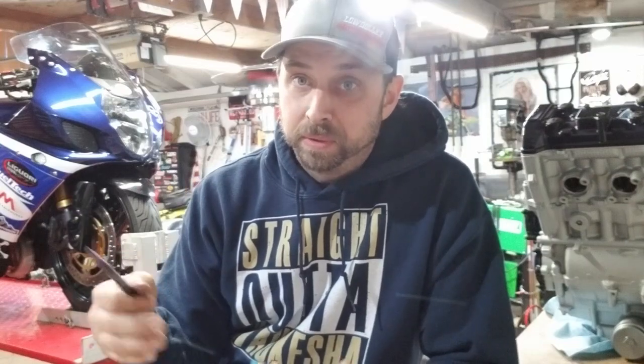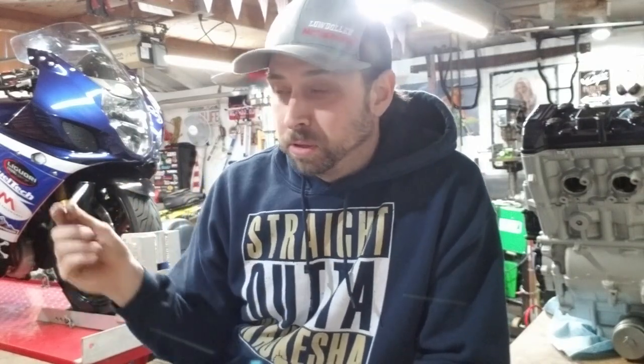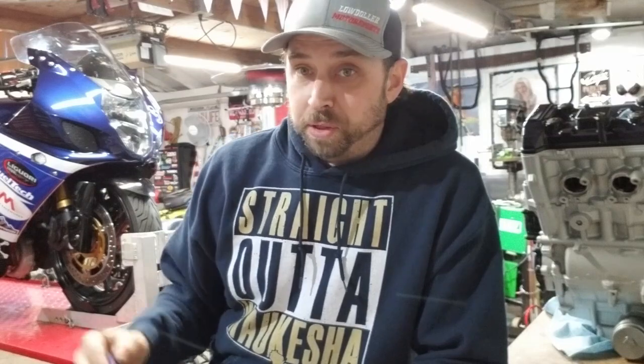I could go to a 62 millimeter turbo and have a Pro Street turbo on it. Again, I don't need it. It's a little more to spool. Nah, I shouldn't even say that. The technology and the wheels and stuff, it'd spool just as fast. But this turbo itself is capable of making more boost than I'll ever run. So why do I need one that makes 20 more pounds of boost than what that'll make? You're just getting into an area I don't need. So the whole package itself is a little bit smaller, but the exhaust housing is, if you don't understand the AR numbers on a turbo, in simple terms, just how much exhaust it'll flow.